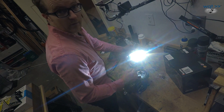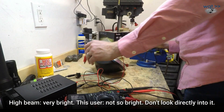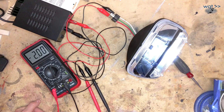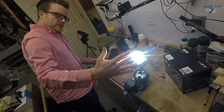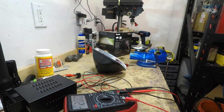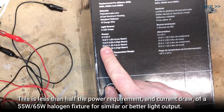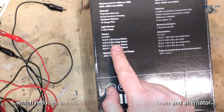Low beam — that's the top one coming on, quite bright. High beam turns on both the bottom and top, and that is extremely bright. The name brand unit produces a very good beam pattern; Headlight Revolution did a shootout on this style of sealed beam replacement and TruckLite was one of only about four that actually passed. I'm getting a fairly clean, flat white output — exactly what you want from a good LED headlamp. It's drawing about 1.11 amps at 13.8V for low beam and just about 2 amps for high beam, right in line with the spec of 1.28A low and 2.06A high at 12.8V.